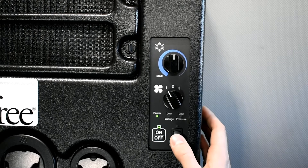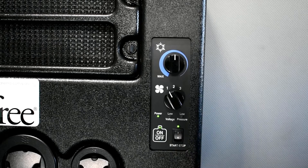The automatic start-stop switch is located next to the power button and must be turned on to enable auto start-stop, allowing for automatic recharging of the batteries. A green light will illuminate, showing the feature is turned on. When the auto start switch is in the ON position, the EAPU will monitor the charge level of each battery bank and automatically start the truck's engine to recharge the batteries. If the switch is left in the OFF position, the automatic start-stop feature will not work.